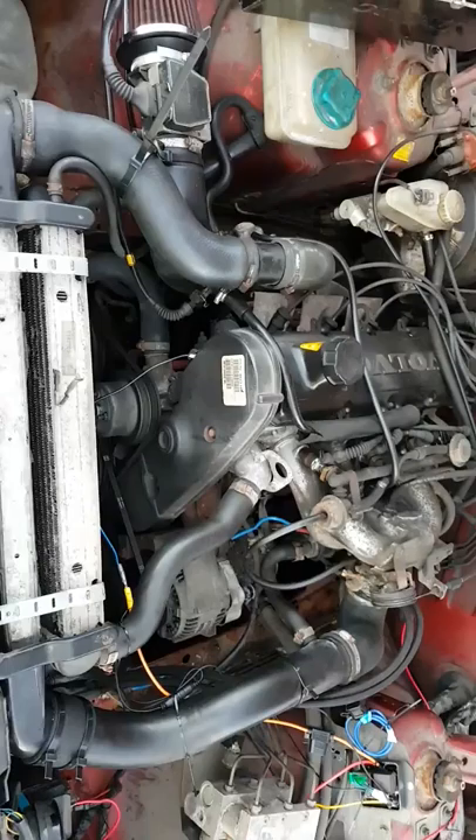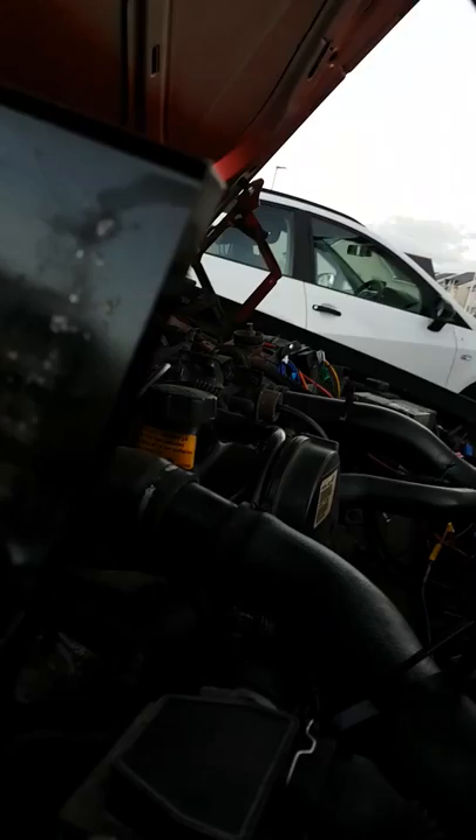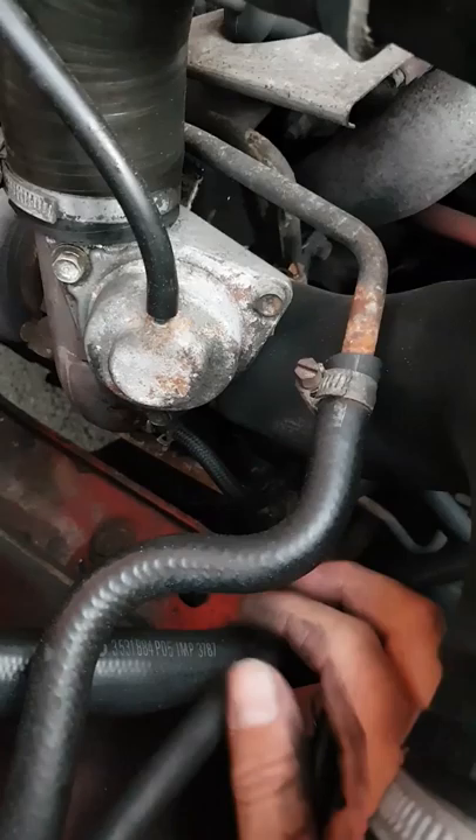Let's look at my engine. I should probably mention that I have super-chipped this car. Because it's still the little 13C turbo — which is tiny — and I've got the LPT modification. Removing this and holding the wastegate shut gives you full boost all the way up to redline after chipping the car, and it is an absolute animal.